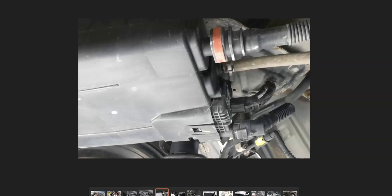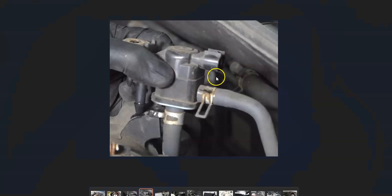Next, check to see if there are any EVAP leaks around the hoses that run inside the EVAP system. They'll run from the gas tank underneath the car to a charcoal canister, then up to the engine to a purge valve. Go around and check all these hoses for any obvious leaks, cracks, or anything like this. If you took it to a mechanic, they'd feed smoke into the system — if smoke came out, there's an EVAP leak. You likely won't have a smoke machine, but check if any hoses are cracked or came loose, as an EVAP leak can cause this code.